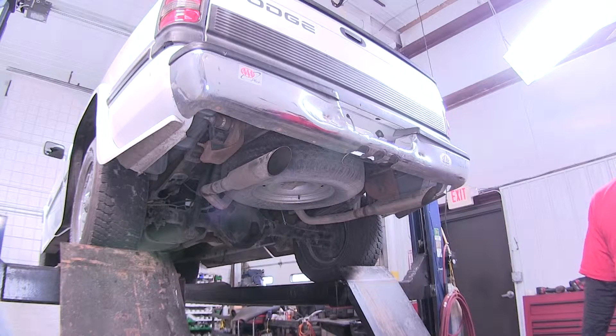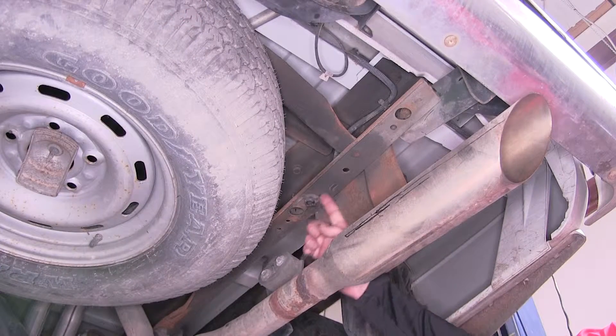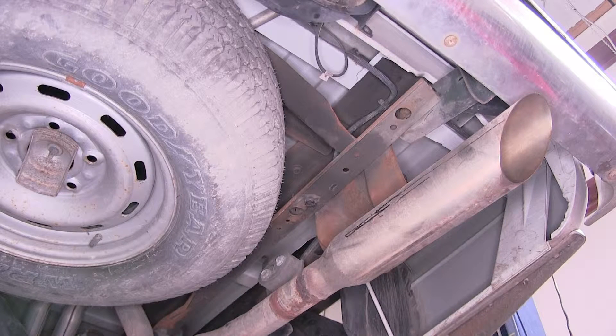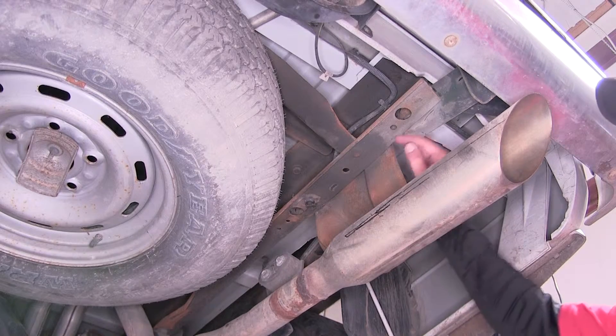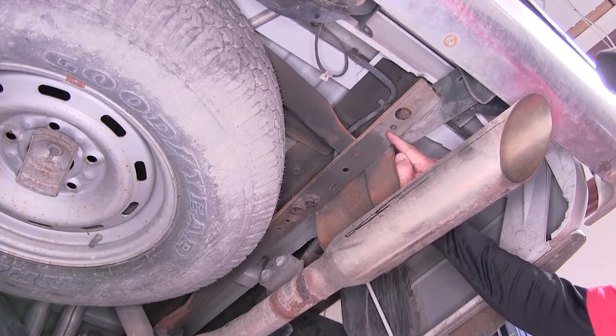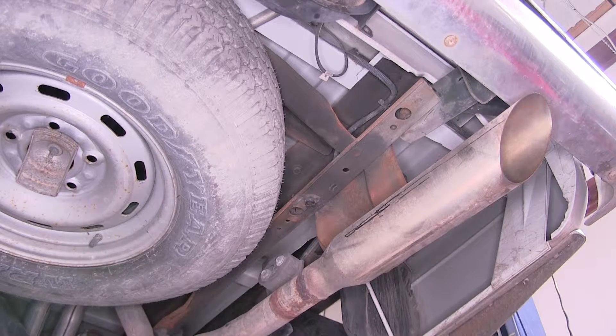Now let's go ahead and point out our attachment points. We're going to have a total of six attachment points, three on each side. Depending on your application, your attachment points could be pre-drilled holes already in the frame. This one already has three half-inch pre-drilled holes. However, the hardware for our rear attachment point is going to be a 9/16 carriage bolt and block, so we'll need to enlarge the rear attachment point hole. Keep in mind, each process we do here on one side will be repeated identically on the opposite side, as our attachment points and hardware are the same.